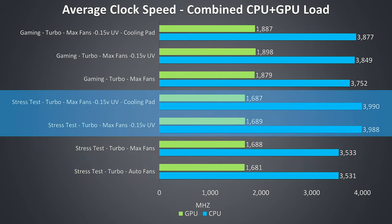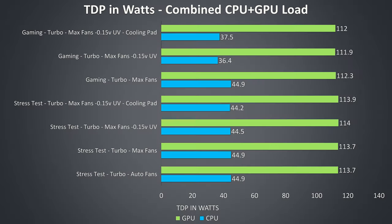It's the undervolt to the CPU that improves performance the most, allowing us to hit the full 4GHz all-core turbo boost speed of the i7-9750H. These are the average TDP values reported by HWiNFO — basically nothing really changes until we undervolt the CPU. It lowers a bit below the 45 watt limit as power limit throttling is only just removed, and there appears to be less of a requirement for CPU power in the game tests, as identified by the lower TDP values there.